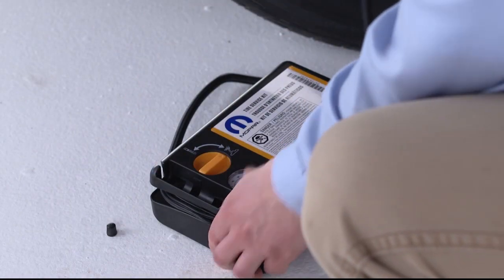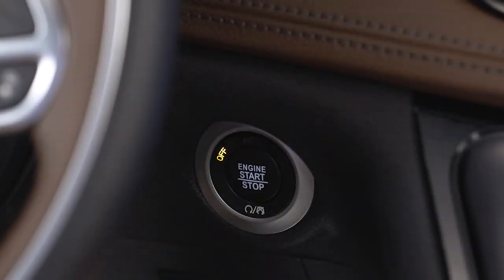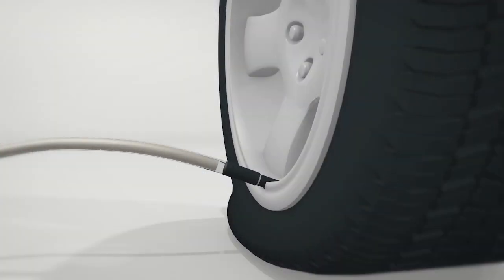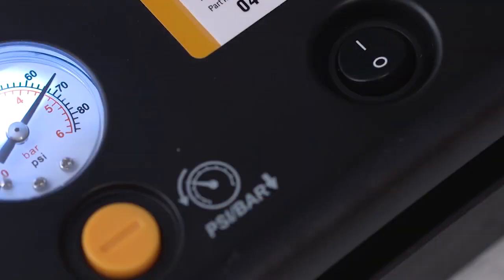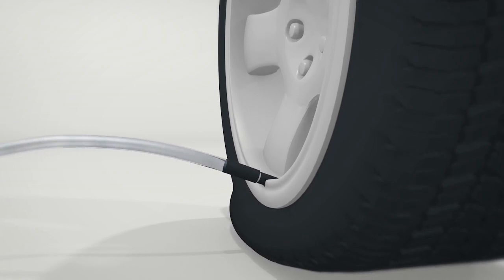Next, uncoil the power plug on the kit and connect it to the vehicle's power outlet. Go ahead and start the engine. Push the power button on the tire service kit and the sealant should start flowing from the bottle through the hose and into the tire. Run the pump until the sealant stops flowing into the flat tire. The pressure may read up to 70 PSI or 4.8 bar, however it will quickly drop once the sealant bottle is empty. The pump will start to add air into the tire after the bottle is empty.